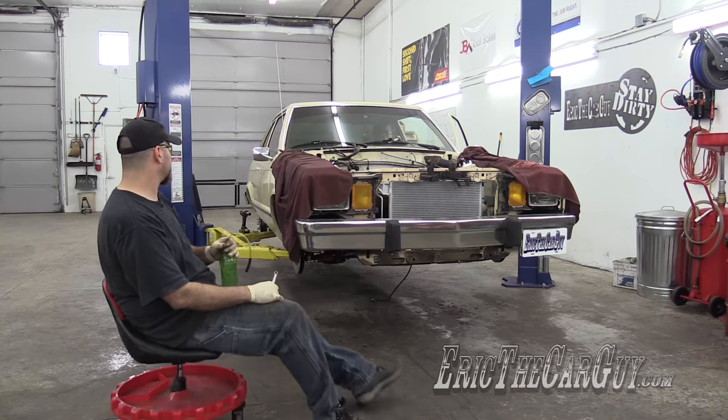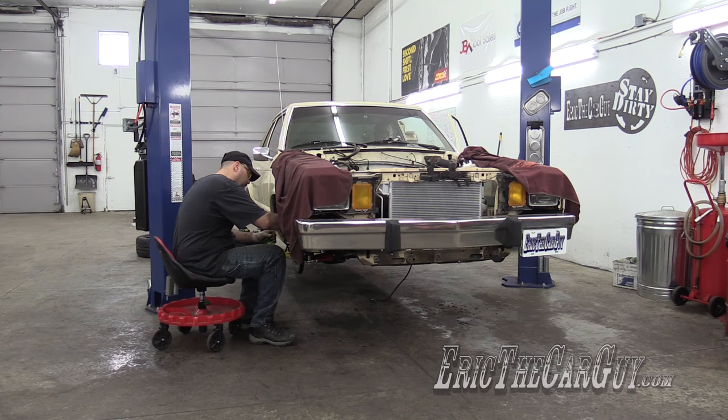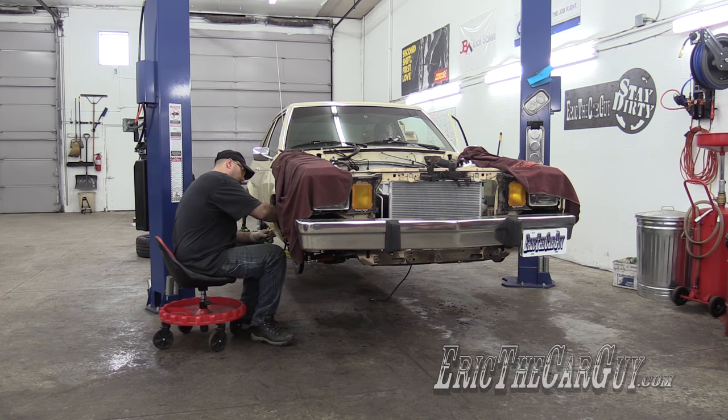Now it's time to bleed the air out, and yes, I'm using the old school method of Brian in the driver's seat looking for a good brake pedal. We've got some high-performance hoses all the way around, high-performance brakes, brand new all the way around, warped rotor on the right — I know — but I will deal with that. You know how to bleed brakes. I'm going to start by just gravity bleeding, so I'm going to open up these two front ones and just let it flow.